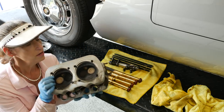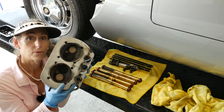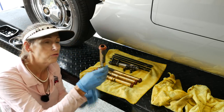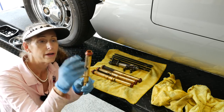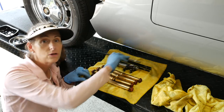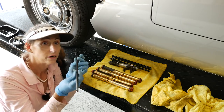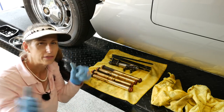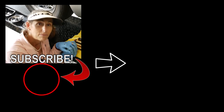Today was a success — we got the head off. I don't see anything too obviously wrong, no obvious burnt valve, but I have a feeling the valves are sticking. So off to the machine shop. The rest of our parts are laid out and we'll clean them really well. The pushrod tubes were leaking as well — they had some kind of red sealant schmutz on them, so we'll replace all the seals and make sure everything is completely clean and leak-free when we install it. We also validated that we have steel chromoly pushrods, which means we have to set our valves at zero clearance. I hope you enjoyed this episode — please give it a thumbs up, leave questions or comments below, and stay tuned for more adventures with the Beck Spider. Until next time, safe travels!